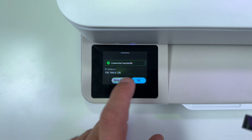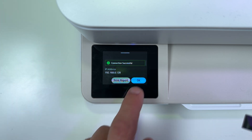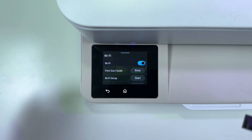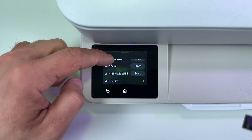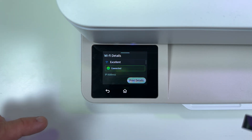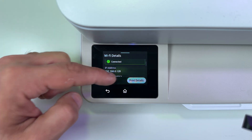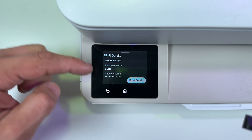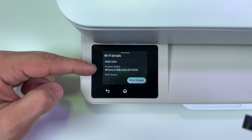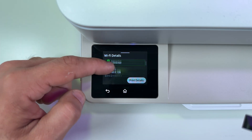So if you need it just write it down. Press OK. You can also print a report, but we won't do that now. I will show you how to see your wi-fi settings. Stay in the wi-fi menu, scroll down, and tap on Wi-Fi Details. Here you can see the signal strength, connection status, IP address, band frequency, network name, host name of your printer, Bonjour name, IPv6, and MAC address. All details you can find here, and you don't need to print a page each time you need to see the settings.